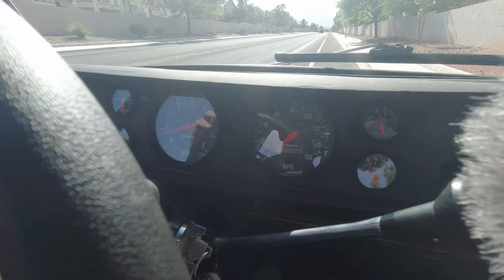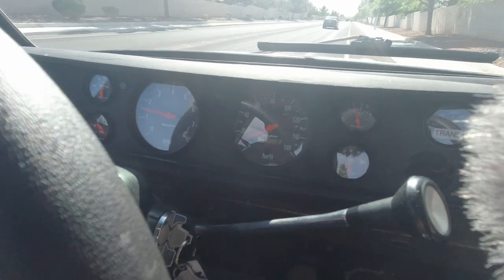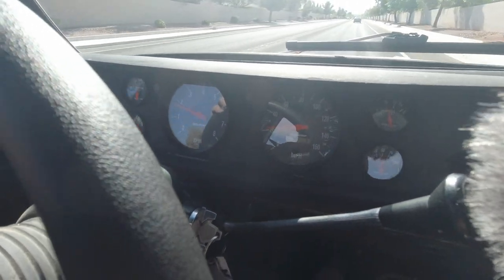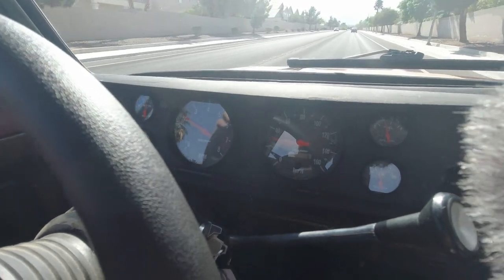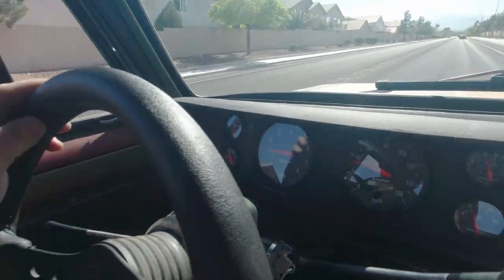We'll let this car pass and I'll pull out and see if this thing works. Looks like it's working to me. Next test would be to throw open the speedometer app on my phone and compare the two and see how it looks. So I ended up firing up the speedometer app on my phone and compared it to the reading on that Autometer speedometer, and they were within one or two miles an hour. Pretty happy with that. I may end up doing another calibration later, but we'll see.